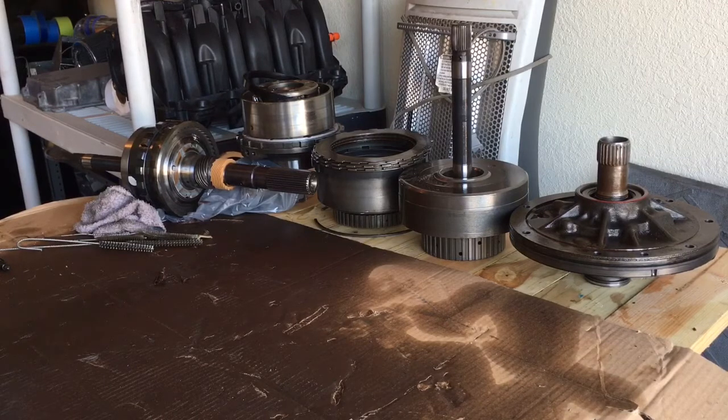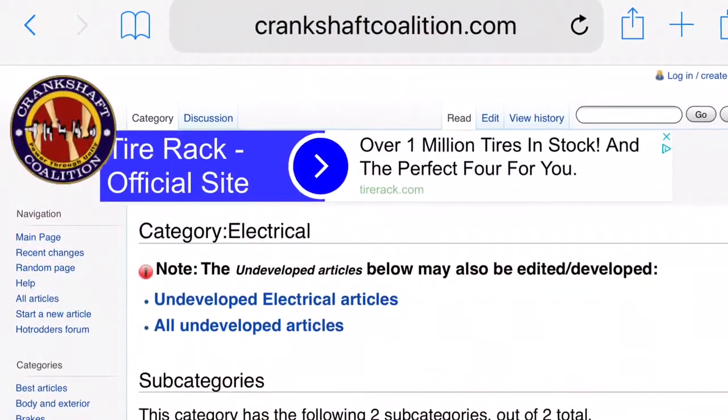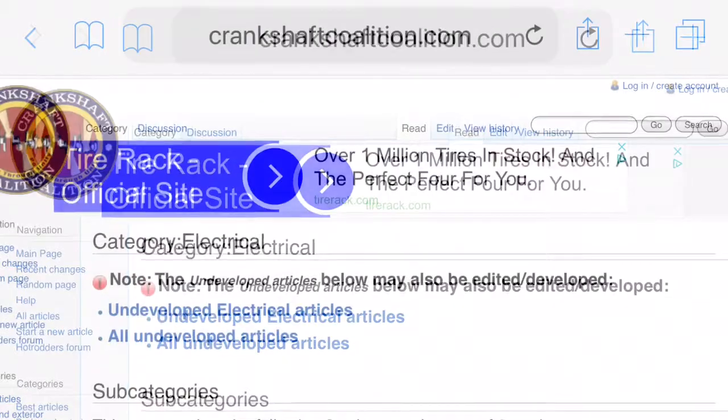I'm going to roller-ize the case. In this case, I'm going to be ordering a heavy-duty rear case bushing that is slightly longer — you purposely leave enough of it hanging out inside the case to locate a Torrington roller bearing from a Turbo 350 pump.